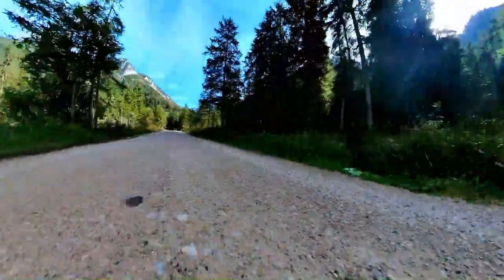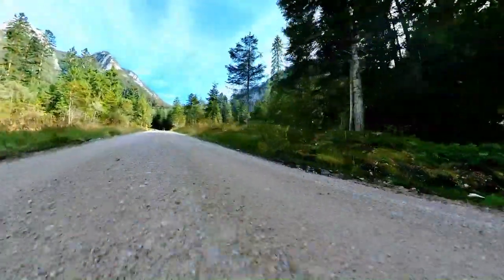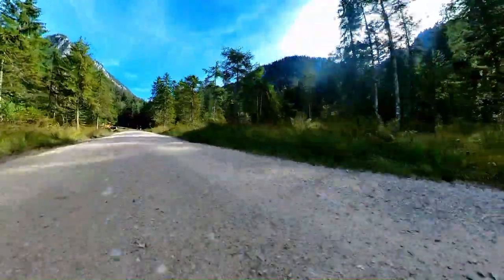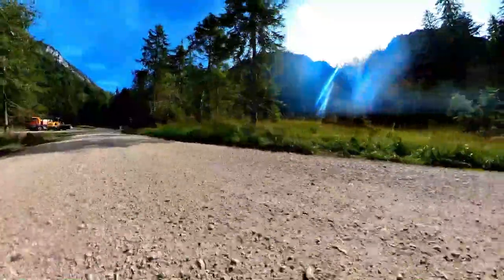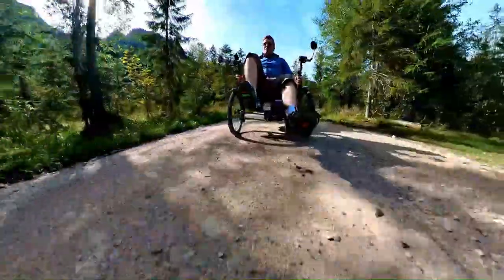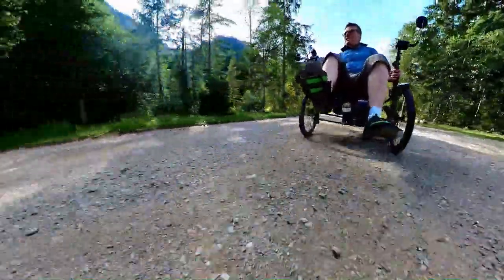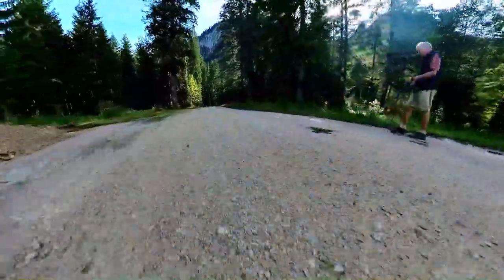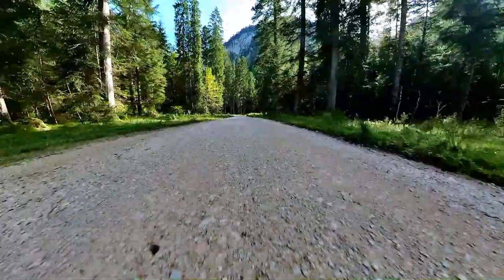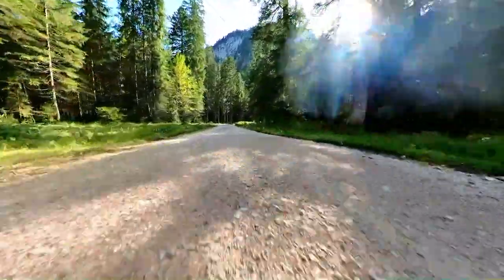Now, one of the things I probably won't show you in this video, I've showed you the Rohloff, the Extreme for climbing down to the first gear, but probably never going to use our 13 or 14. We do have 14 gears. 14 is for downhill and going really fast. You know, you could pedal 50 kilometers an hour and still keep pedaling. On a lot of bikes with a narrow gear ratio, you're going to find once you get to a certain speed, there's no point in pedaling anymore because your legs are spinning so fast. Here we won't have that problem, but of course we don't want to quite go that fast since we want to enjoy the scenery.